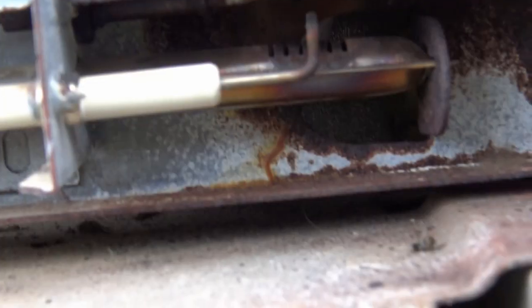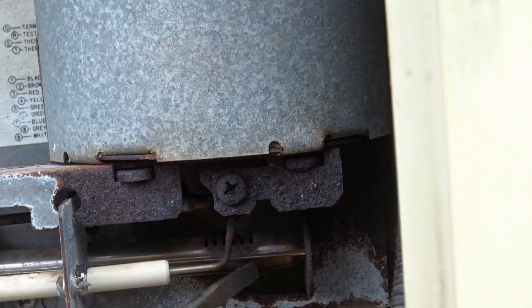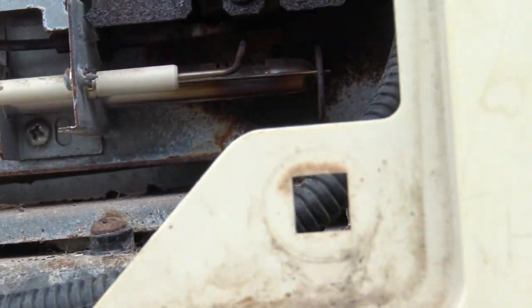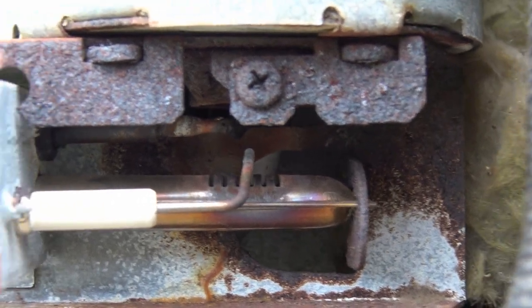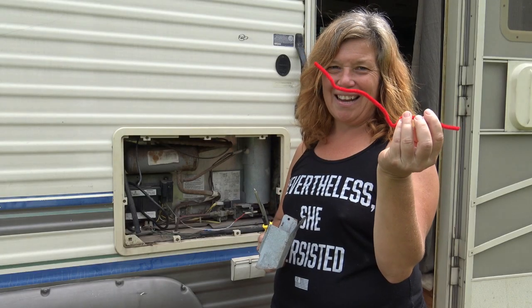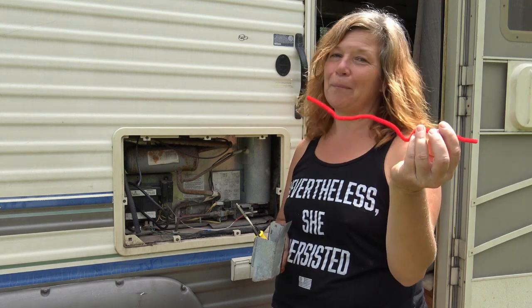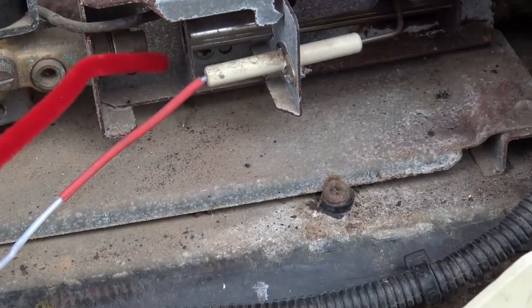You can see the burner right there. So you see this shiny metal? That's the burner in there. I want to be careful — I wanted to take that out and clean it because I had seen a video on how to do that. There is a screw right here, but I can't get that screw out, and I didn't have my drill handy. Since I couldn't get it out, I decided to see what I could do with it still attached. I had picked up some pipe cleaners — all I could find were red unless I wanted a pack of 100. I wanted white ones so I could see the dirt coming out, but I got fancy red. Then all I did is stick this into the burner assembly and cleaned it out.